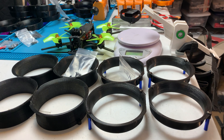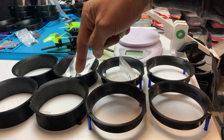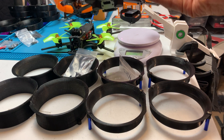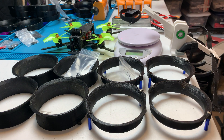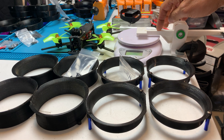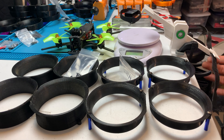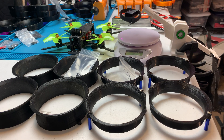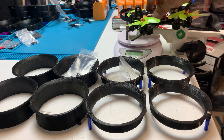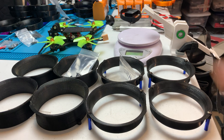Right here I have the OG Shendron's Squirt ducts. I believe they're the same as the V2 as far as shape goes, but I'll test that later on. I have a V2 Squirt here that I'll be testing later, but it was just easier for me to test the V1s on my new rig. I have a kind of seesaw setup that I just quickly designed, and basically I'm going to strap the drone onto the end of it and spin up the props and see how much pressure it puts onto the scale so I can measure relative thrust between the two different ducts.